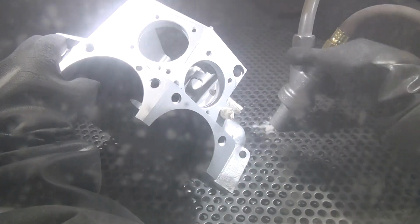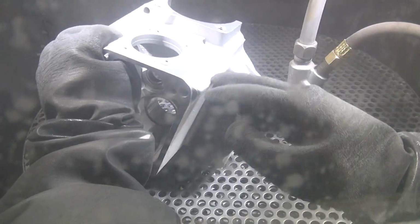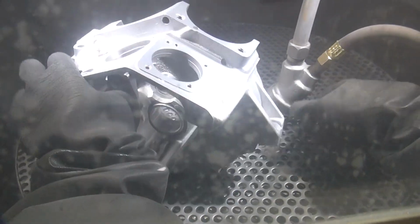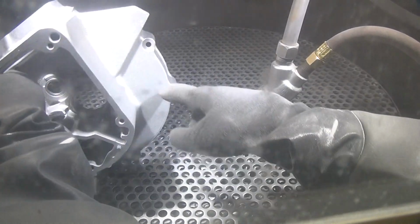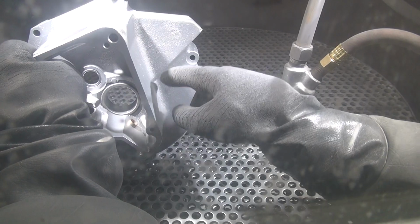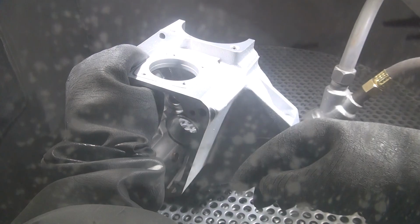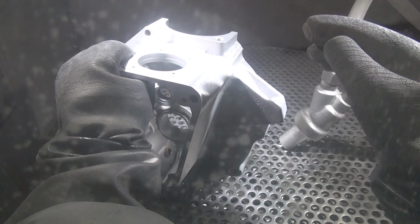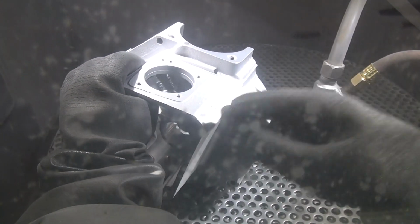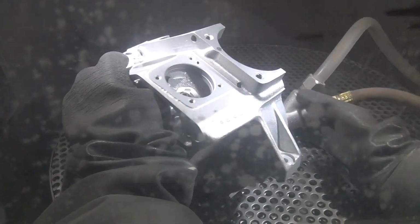What do you think those four stars are there for? There used to be a VIN number there. In the 70s the VIN numbers were here, 80 numbers were here. At some point they went to the other side, probably 82, 83. On the FLT, they were down here. I can't remember if they went vertical or angled, I forget. But all the other numbers are right on this boss here. 70 all the way up to 81, they're always here, except on the FLT. They put the stars there so you know it hasn't been ground flat or something stupid. Oh, I see. You go look for the number somewhere else.